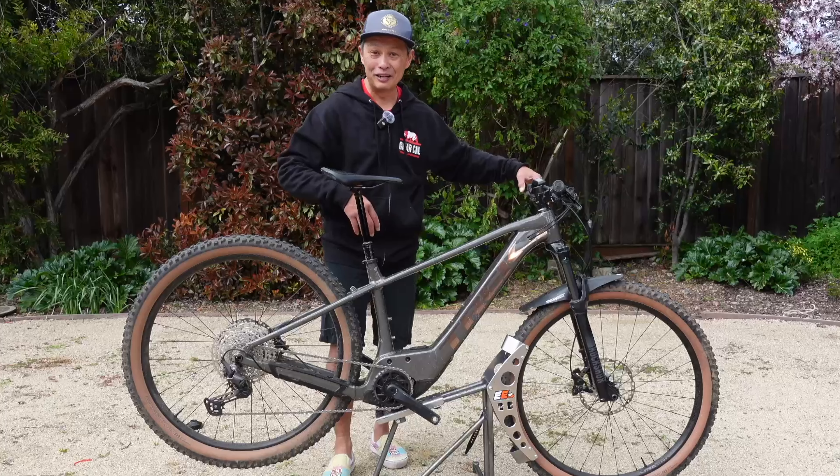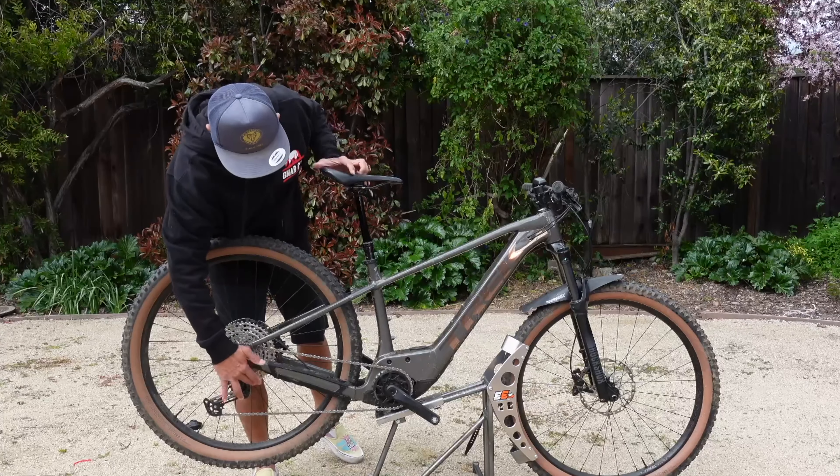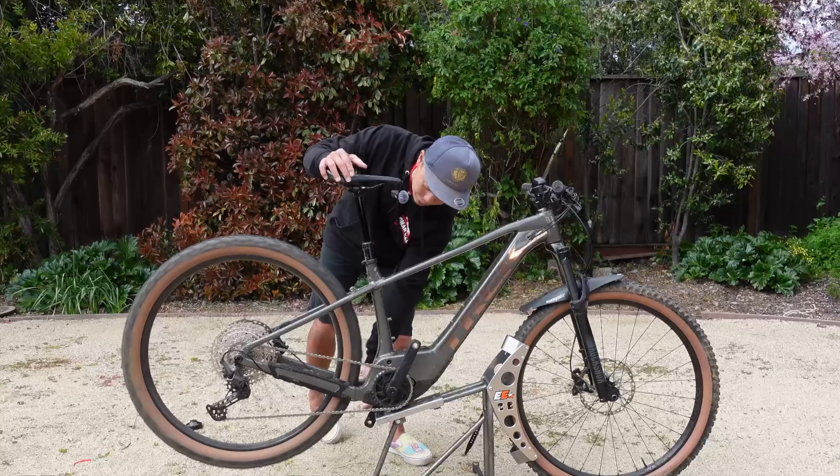At $3,500, what you get is basically the Marlin with a motor — it's got that same geometry, 66.5 degrees on the head angle. The seat angle is a little slack, got a dropper post, and the chain stays are on the long side at 470mm with 29er wheels. The 29er wheels are good because it's a hardtail. I haven't ridden a hardtail in a while and I'm not gung-ho about e-bike hardtails because you have a lot of unsprung mass — you can't just float like a butterfly, and there's mass to deal with that has to be controlled.